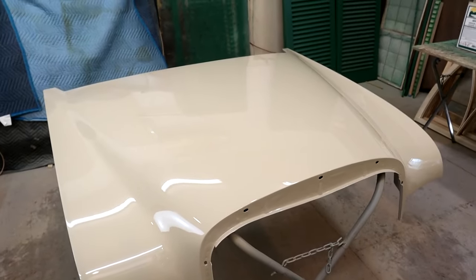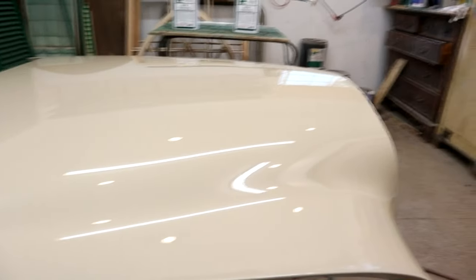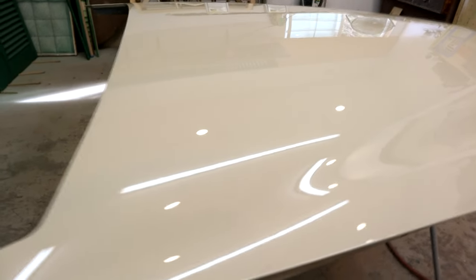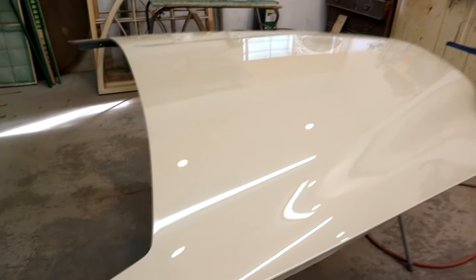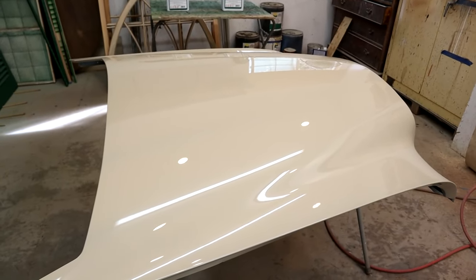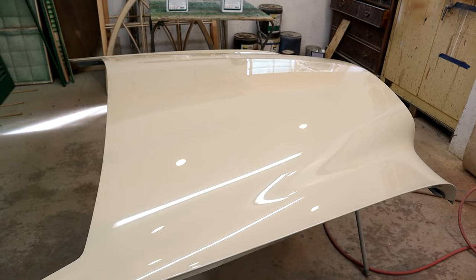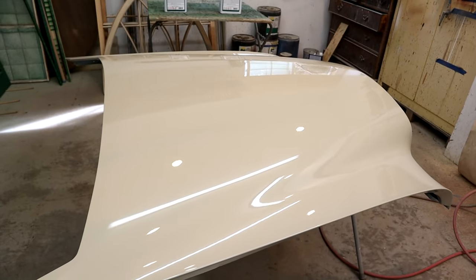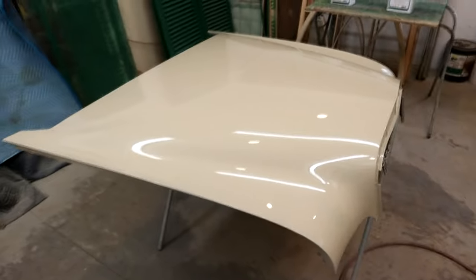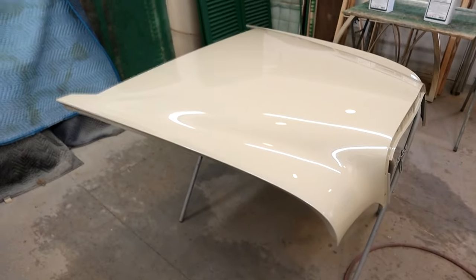You can see the sheen is looking really nice, got a nice reflection in the light there, not wavery or anything. Like I say, it's just the first coat. That HTE tip is not HVLP - it's the HTE TE10 tip on the DeVilbiss. Puts down a really nice smooth glass finish. Also another trick, similar to finishing wood: I use what's called a retarder, and it slows the dry time down to allow the finish to flow out depending on the weather.